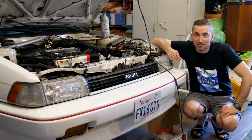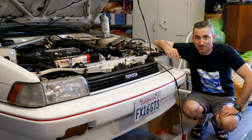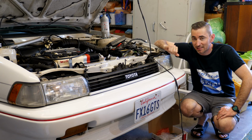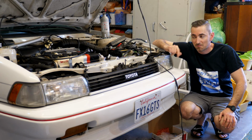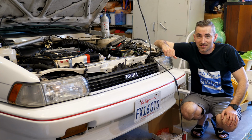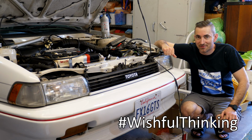So after a lot of trial and error, making sure I had fuel, making sure I had spark, it turned out that it was the timing. So the offset was one rotation off. Even though I was getting the correct timing flashed on the crank, it was one rotation off, so it was igniting at the wrong time. Now that it's starting, I can set the correct offset and then we can lower the car and take it for a drive.